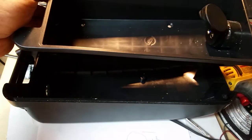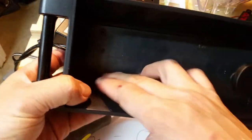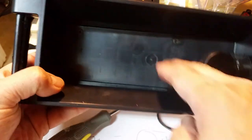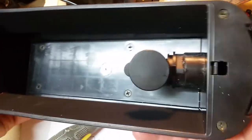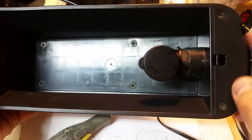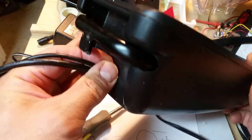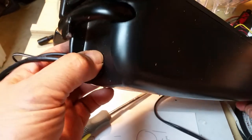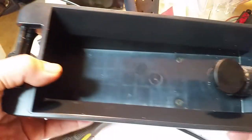I'm going to go ahead and put this back together, then run the cable underneath and out through the back. The base is back together — put in these four plus two screws. You've got to make sure those cables are running right down the center and not on top of the screw holes when you're screwing back in, otherwise it won't fit nice and tight. It's a really tight, finicky fit — you've got to hold the spring while putting it back together.